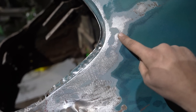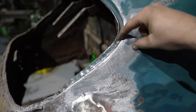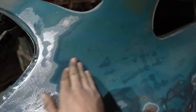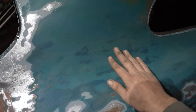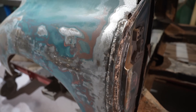We're gradually uncovering all of these little secrets hidden inside this little Porsche. I wish it could speak and just tell us what happened. This section I've ground and sanded back looks nice. You can see all the factory spot welds and the original lead — this shiny silver is actually lead where they would lead-load, essentially almost like a filler, but done in the factory. That will run across here where the two panels join. There's no filler in there and no big horrible weld. It's almost time for Make It at Market to start, so I'm going to sweep up. John is back tomorrow — to be continued.